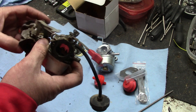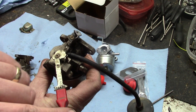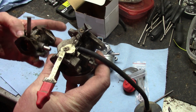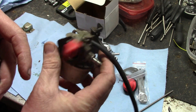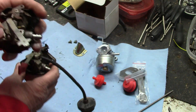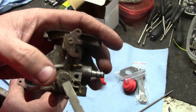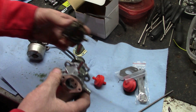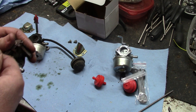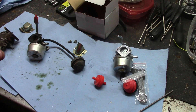That's not gonna work. The problem is there's a spring right here that keeps tension on that lever when you're turning your choke on and off. Unfortunately, on this one the spring's on the right hand side. This is the used carb I had in the shed - this is the carb I took off - this one's on the left hand side. Same problem with the new one I bought - it's on the right hand side, this one's on the left hand side. So that was the other plan - just swap the arm onto one of these other two carburetors - but it's kind of bent.